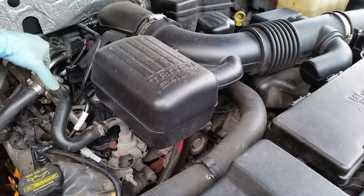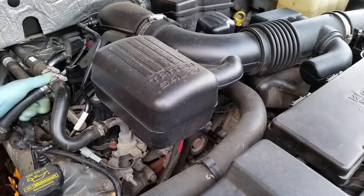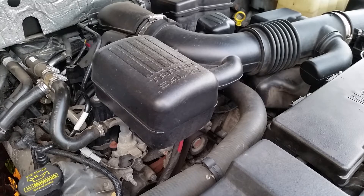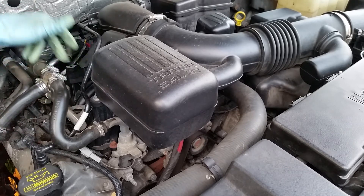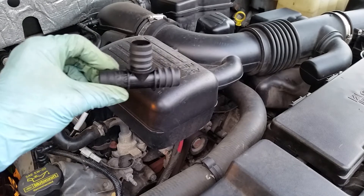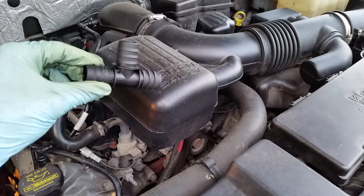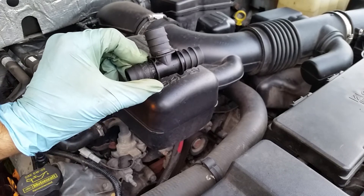So I got the brass T in here and connected back down. There are also two O-rings in the quick disconnect — if they're leaking you can just swap the O-rings out, and really that would be better anyway rather than spending another hundred dollars on a new hose assembly that's just gonna break again with the plastic T. This is the permanent solution — peace of mind. If you're towing a boat, you're not gonna pop this T fitting, because if this thing lets loose it's gonna be pissing everywhere. You'll probably unload the cooling system within minutes and you're not limping it anywhere.